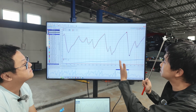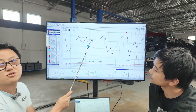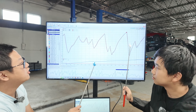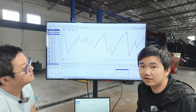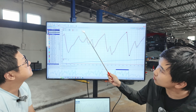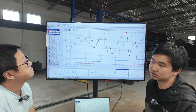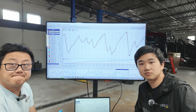Even if you take away the small driver mistakes, it's still probably almost a full second improvement. We'd probably be looking at a 40.5 versus a 41.5. For sure about a one-second gap. The most interesting bit is that the average lap speed is basically 0.8 miles per hour faster — so with camber we gained 0.8 miles per hour of average speed, about a mile per hour more everywhere in the corner minimum-speed-wise. Pretty cool.